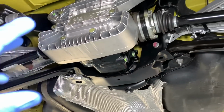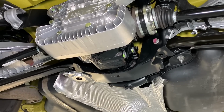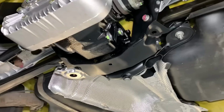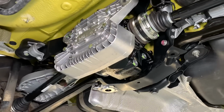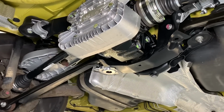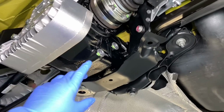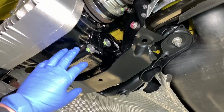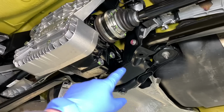We've also gone for a diff overhaul. On our website, as you can see, we've got lots of different options for diff overhauls, and this is what we call an option 5. It's an original diff that's overhauled with new clutch plates, new bearings, new seals. The casing is all stripped apart and shot blasted and then painted with a 2K durable paint finish, and a new rear cover, so that gets you new bushes front and rear.